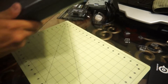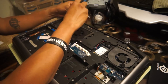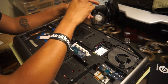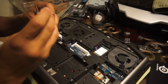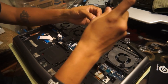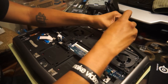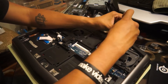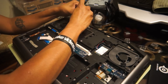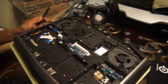So now that that's done, turn it back over and you're going to install your screen hinges. Let's do that first in specific order. I'm going to put them all the way in and then torque them at the end. You should be able to just push with two fingers until your finger starts slipping — stop, you don't want to go any further than that.